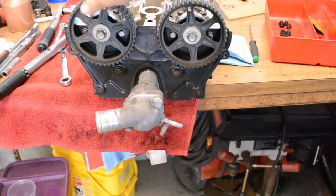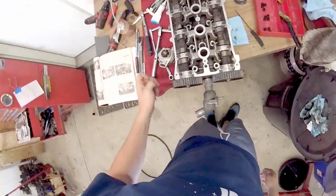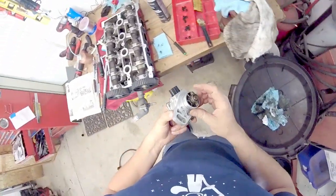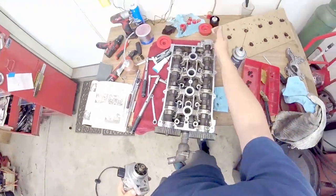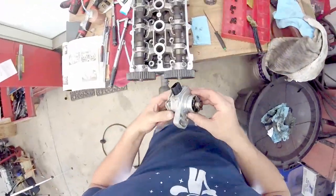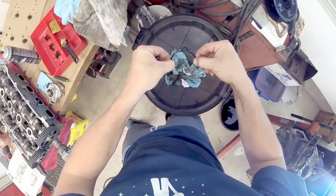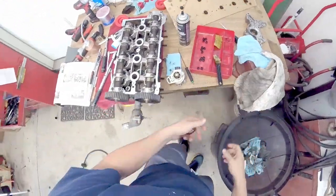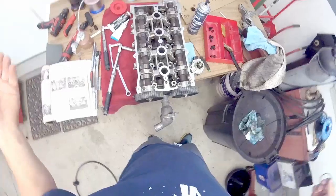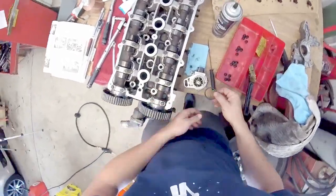When you go for reassembly, this is close enough to top dead center — I'll have to rotate these a tooth or so over and lock them in. On the cam angle sensor, this little widgeridoo flies around, goes in the notch in the cam, and tells the computer where it is in terms of timing. The seal on this thing was so crusty it's not even rubber anymore — it turned into plastic. Symptoms of this are a whole bunch of oil leaking down the back of the head, which this car had. New ring comes in the Mazda kit, goes on, sensor goes in — no big deal.